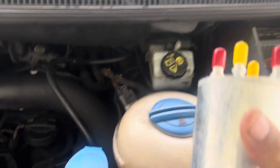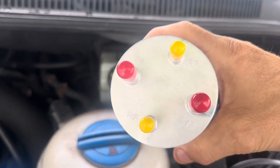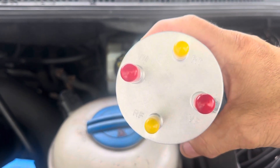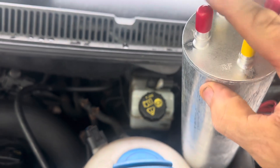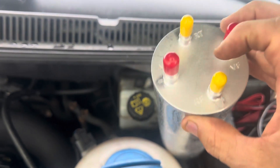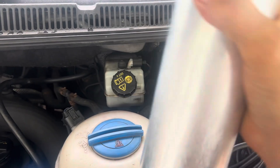So you can see what you're talking about — look, there you have four inlets and outlets and they're all marked. You've got VF, RF, and VMRT. I think the R's are returns and the VF comes from the tank. This goes to the pump, it comes back from the fuel line and that's returned to the tank. We'll take it off here so we can see exactly how it's set up.